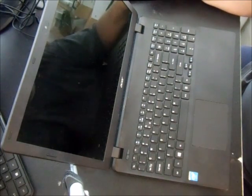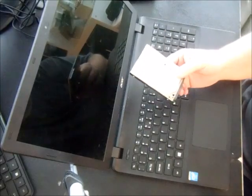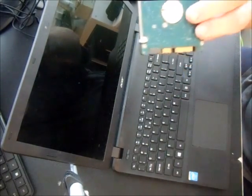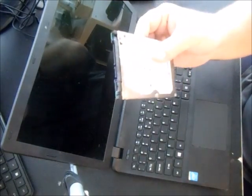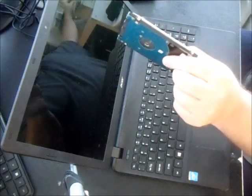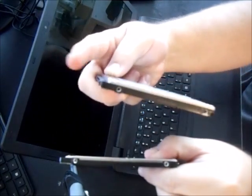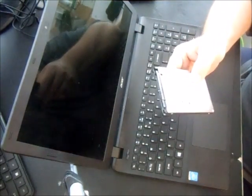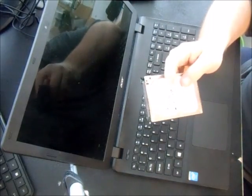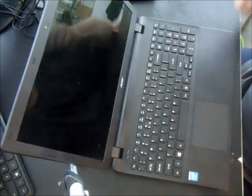You can purchase hard drives online on eBay for around 20 to 30 bucks for this model. You'll see it takes something like a thin SATA hard drive — the SATA has a large and a small connection and is thinner than most drives. The best way is to open it up, get the hard drive out, and read the model number on the drive itself, then plug that into eBay or Amazon to find a replacement.